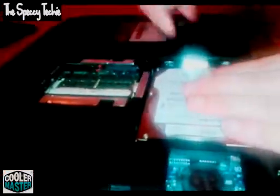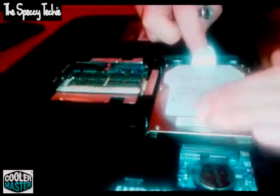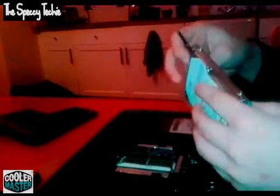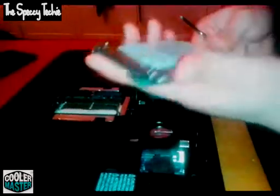Now this isn't a big problem. This is your hard drive — this is very simple to do. Simply push with your fingers across whilst holding this up. You want to then lift this out and your hard drive simply comes out. What you then do is undo these four screws here. Take this metal tin foil style sheet and you want to put that underneath your new hard drive and screw it on in a similar manner. Your floppy bit is pointing away from the socket and the metal bit is covering up all the circuitry on the bottom of the hard drive, so all you have left is your label on the top.